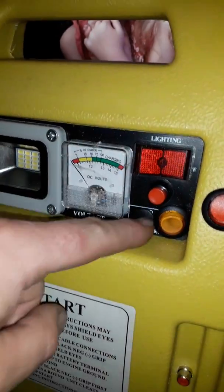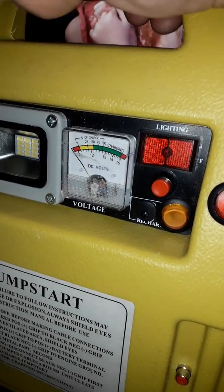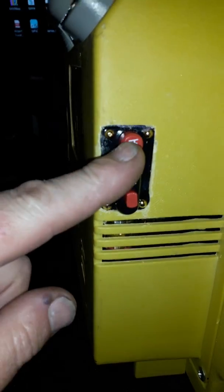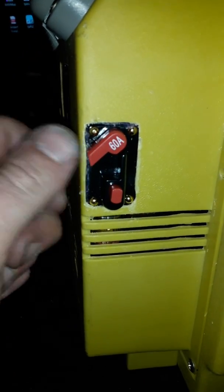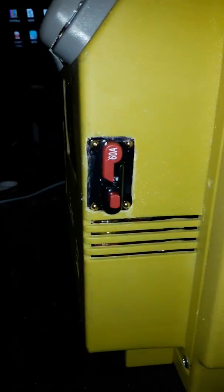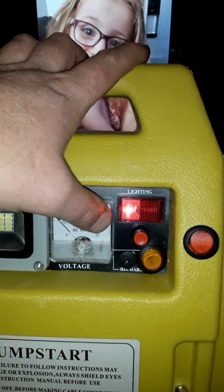You can also obviously plug that into your car, like I showed earlier. So the inverter on this side is wired directly to the battery via a 60 amp breaker. I always turn it off because there is still a drain on the inverter — there's a little LED light on standby mode. Turn it on, make sure it's working, switch on the inverter — you can hear it, it's up and running.